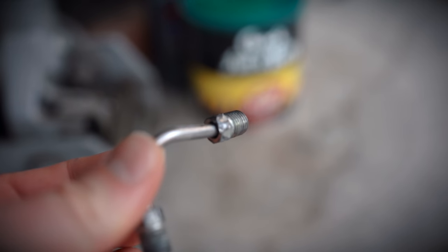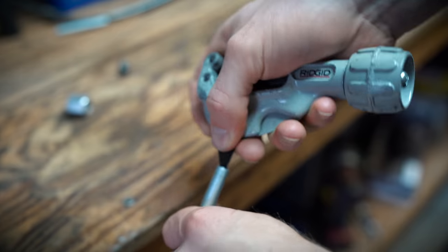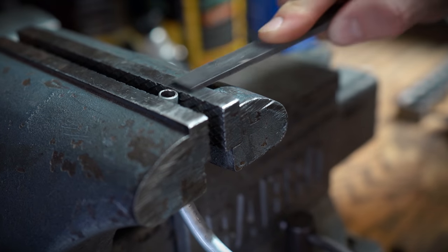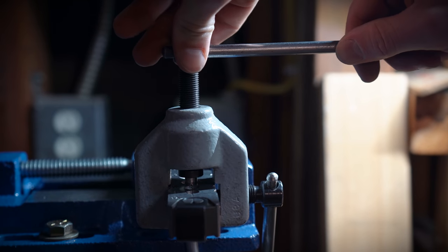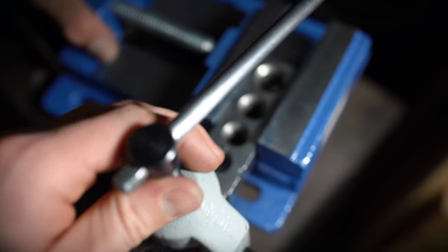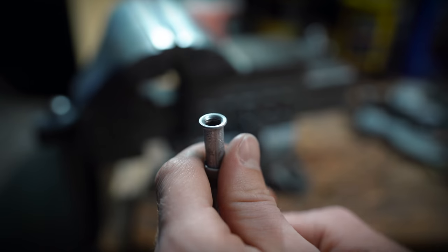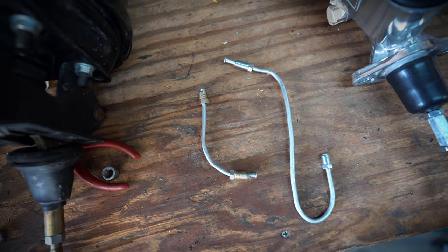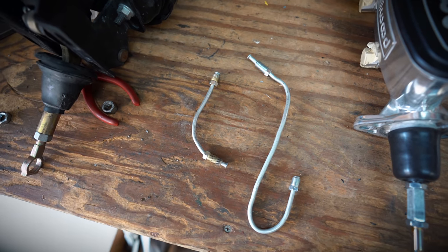After taking off the old brake lines, I realized they weren't usable — they were completely mangled. Even though I used the proper wrenches, the metal is just really soft and easy to mess up. So I had to make my own brake lines and learn how to flare them, which ended up being a pretty fun process — it just took a lot of time to get right. Huge shoutout to Darren Wright from Burbank Choppers for teaching me. It's pretty simple, it just takes time, and if you make sure it's perfect, you end up with a perfect flare.